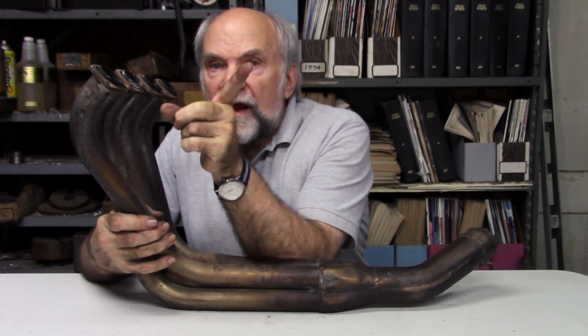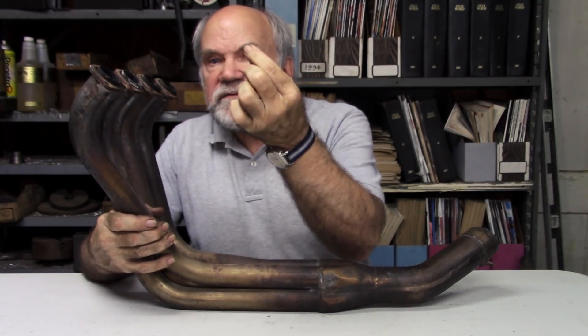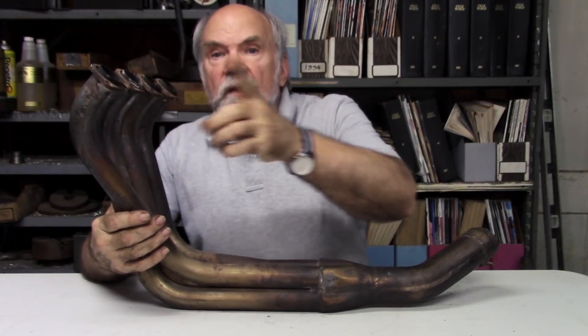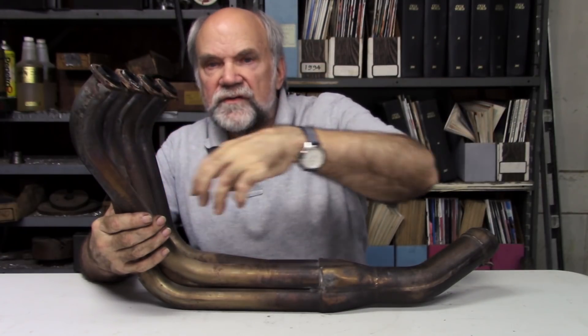This negative wave arrives just in time to draw out the exhaust gas that is sitting above the piston at top dead center. That low pressure then propagates across to the intake valve and starts the intake process early, before the piston has even started to move down. So in effect, what this pipe is doing is advancing the occurrence of some intake by sending back a negative wave that propagates through to the intake system. It starts the intake process, draws out leftover exhaust gas, and in the RPM range in which this effect is designed to operate, it boosts torque.